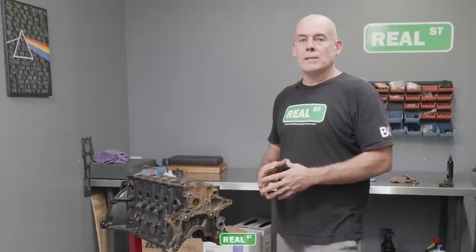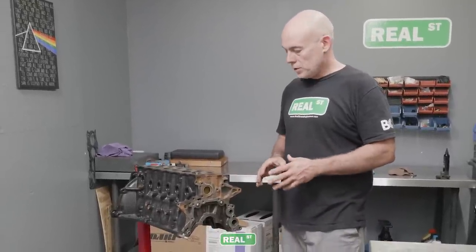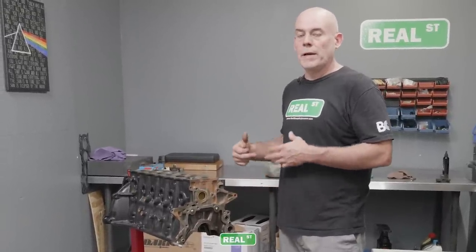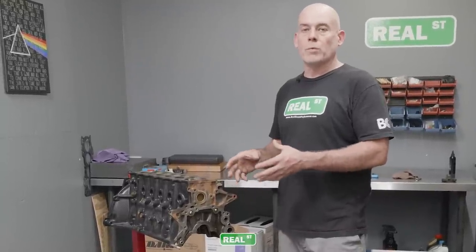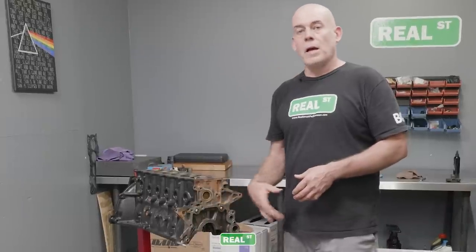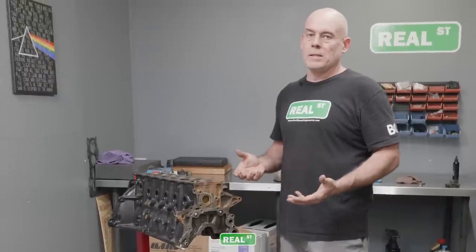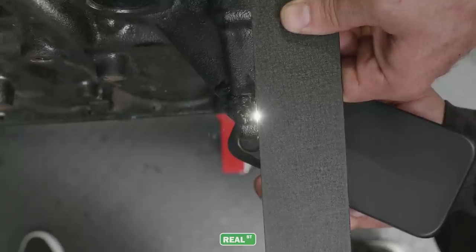I would say the single biggest thing that you can take away from this video, even if you're not a 2JZ guy, is don't ever transport the engine block with any studs hanging out of any accessory ears or engine mount locations. While those ears are incredibly strong to do the role they were designed to do, if you boop this stud, it just breaks the ear off. It happens really easily, and then you have a problem that isn't easily repaired and can create other situations like we're into with this engine.